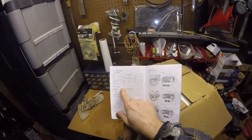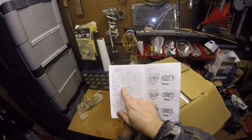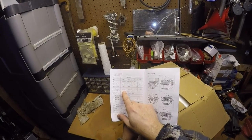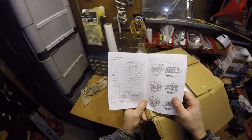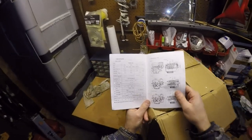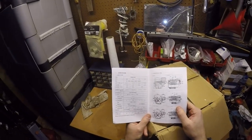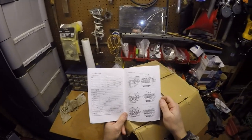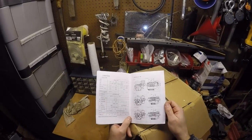So we can back calculate the torque by dividing the power by the speed, and that would give us a torque that we'd have to convert over to pound feet of torque, or foot pounds, or newton meters, or whatever units of measure you like. So we get that much out of there.